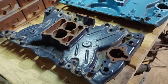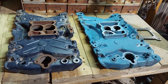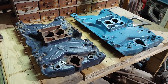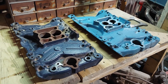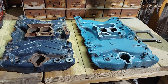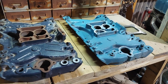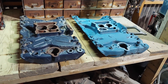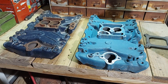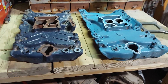You could use these intake manifolds on regular Oldsmobile engines — like the small block Oldsmobile 307, 350, and 403 — but you're going to want to get everything else too: not just the manifold, but also the injectors, the fuel rail, the computer with the harness, all related sensors, the throttle body, and the computer-controlled distributor. It could be pretty hard to find those items, so you'd probably be better off getting them from a complete donor vehicle if you want to use the original Cadillac fuel injection in another vehicle.